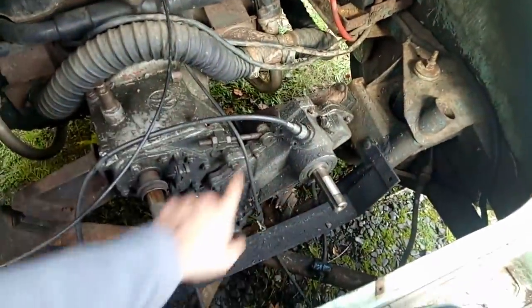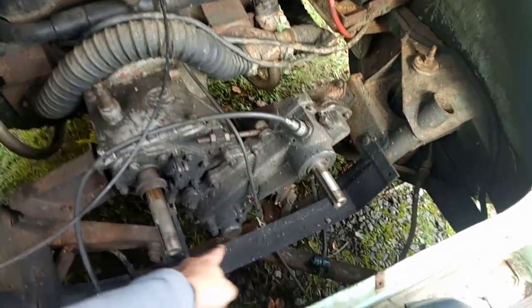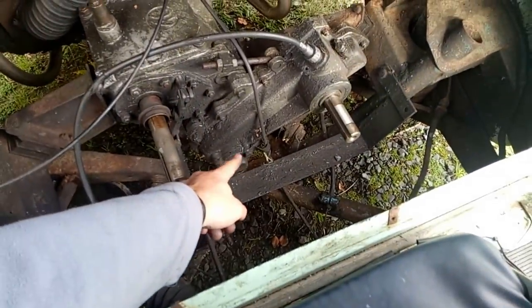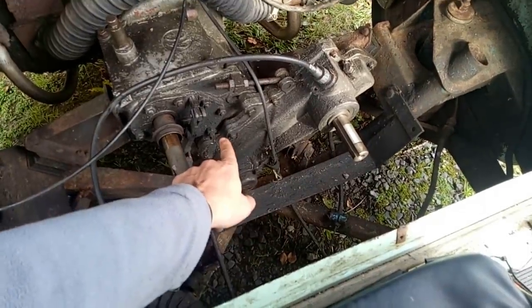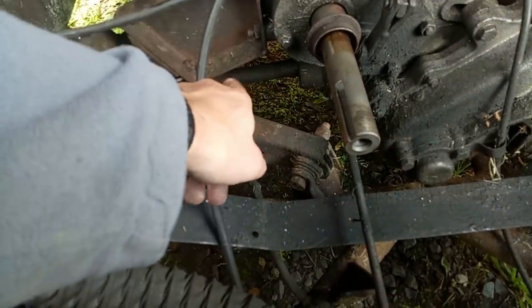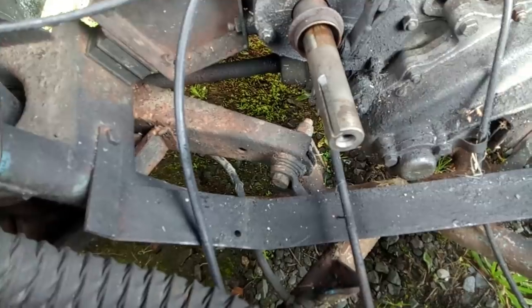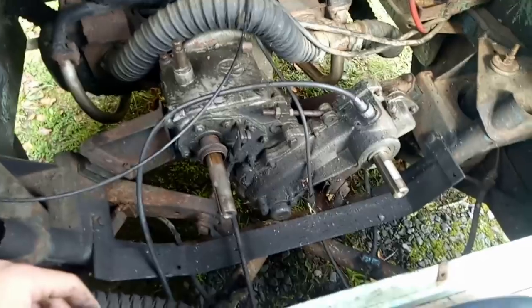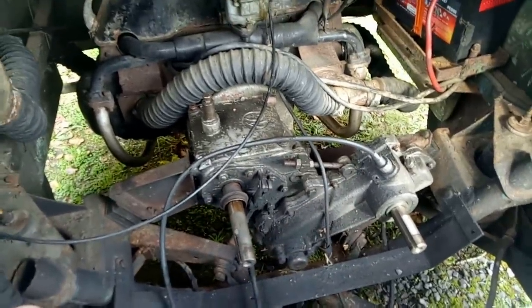In this casing is a chain, so drive goes from this point down to the bottom cog, and that goes into the final drive and the differential. Then power comes out via the drive shafts — one for each rear wheel. They're Fiat 500 drive shafts, which in theory means you could put a Fiat 500 gearbox in here. I don't plan to do that, it's just a fact.